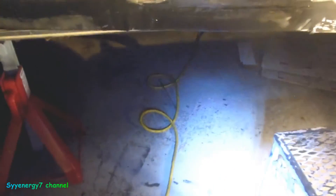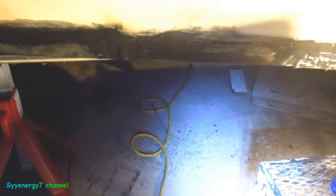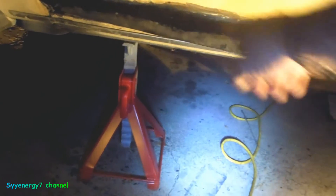This is the thing — I should not have used 16 gauge on the bottom of this door because I was having too much trouble shaping the metal. When I put this 18 gauge up here it was no problem. So I'm going to use 18 gauge on the opposite door — it's gonna be a lot easier. That's my tip.